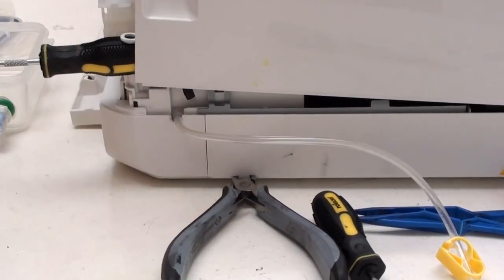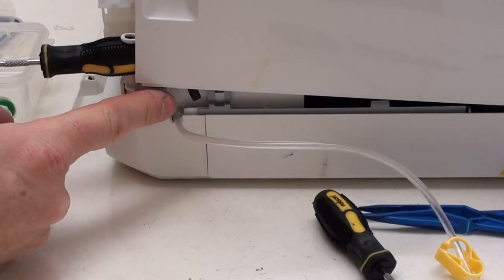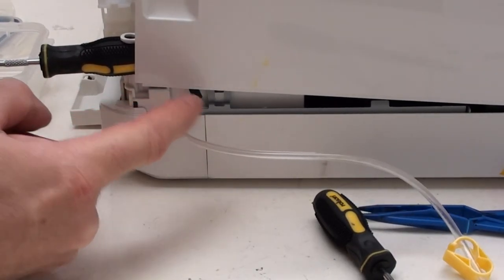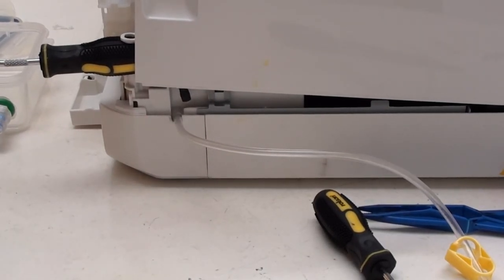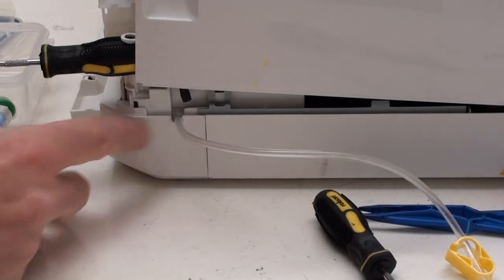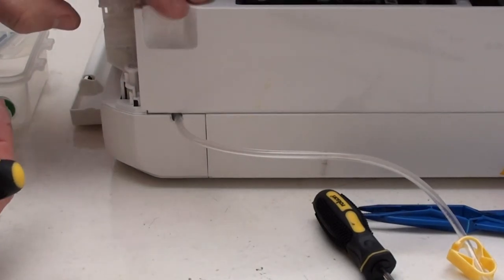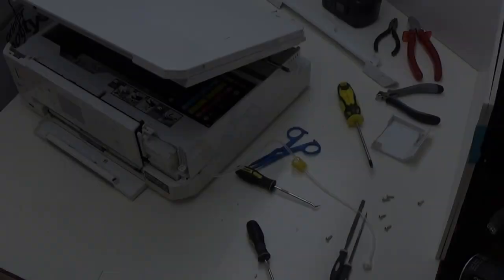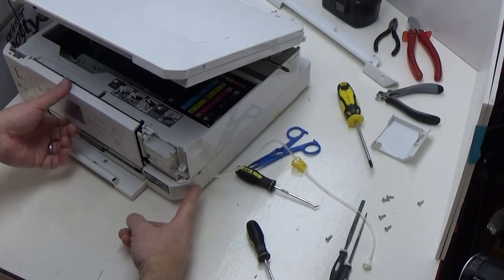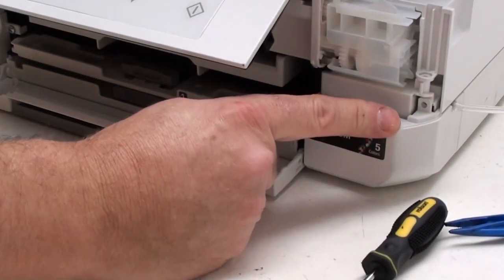Now it sits perfectly — that's the notch cut. The tubing part is now pressed down into its channel and locked in there; that'll keep everything nice and tight. That'll just tuck up out of the way — we can now release that down. That's the hard part out of the way. It's now time for us to reinsert the screws that we took out of the bottom panel.